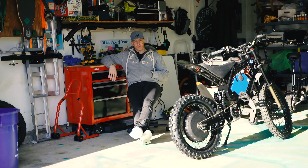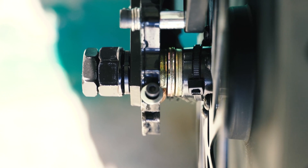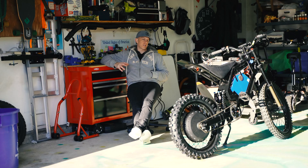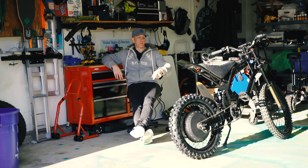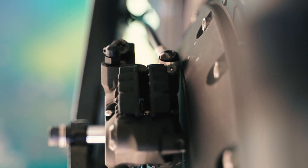It took a lot of work on Sunday trying to get that tire in the right position. I have a few washers on either side — had to take some off, put some on, keep messing with it to get it in the right spot. Once I got it in the right spot and mounted my brake, I realized that my brake was touching the motor. I had the spacers in as you can see, but apparently they weren't thick enough — I should have added another one from the other motor.